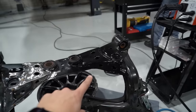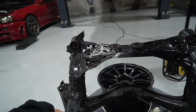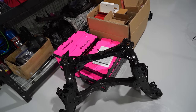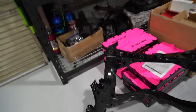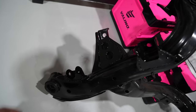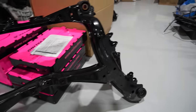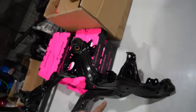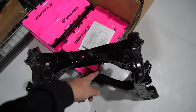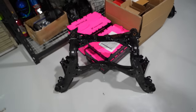I'm going to paint this side and we should be good - this side's already done. We've got to move on to these little pieces after that, but we're chipping away nicely. I've completely finished with the rear subframe now - every piece is welded in and I've already painted everything. I'm really proud of how my welds are starting to turn out. I didn't even have to grind these ones down. The stitch welding actually looks good. I think I'm finally starting to get this. This material is a lot easier to weld than the body of a car, but still - going from grinding down a bunch to just stitch welding and painting over it, I think we're doing real well.